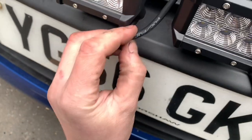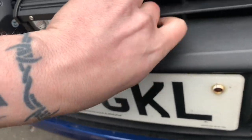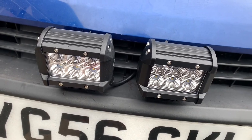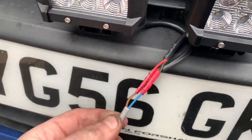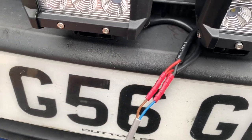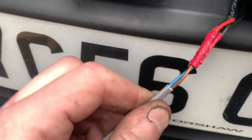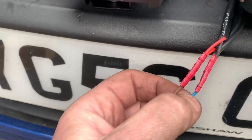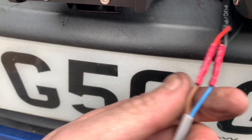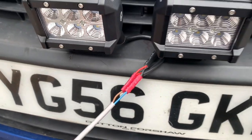It's not going to join together because it's not long enough. There we go — so as you can see now we've linked both lights together so they come on together. This is wiring for a house but it works. I'm using the brown as positive and blue as the negative — it's DC so brown and blue rather than live or neutral. I'm going to wrap that up and feed the wire into the engine bay.